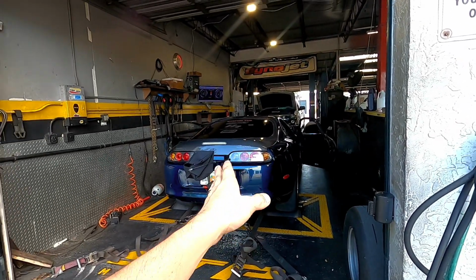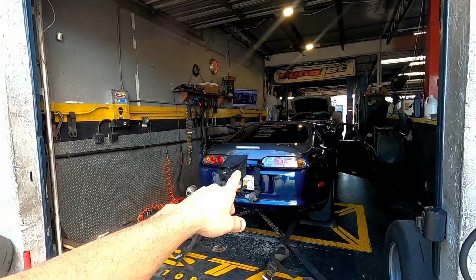The alignment got done. It's looking perfect. Lance was converting the car over to operate on a 7-bar MAP sensor. Before, we only had a 5-bar MAP sensor, good for 60 pounds of boost. Lance said we needed more. So now we have a 7-bar MAP sensor. That can go, I don't even know, 60, 75, it can see like 90 pounds of boost.